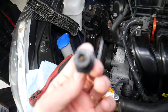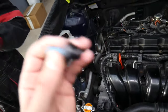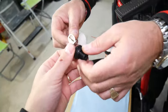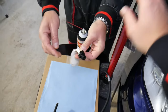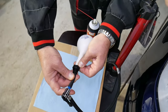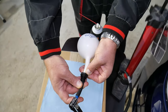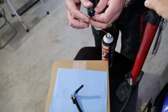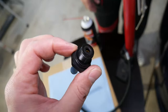Now let's explain how to test it. This is the valve — you can see it's pretty dirty on the inside. When you shake it, you should hear a ball moving inside. Ours does, but that doesn't mean it's working. We'll get a balloon and a pump. You go from the engine side — the valve cover side — and blow it towards the intake side. Check it out: our balloon deflates completely. That means the PCV valve doesn't hold pressure — that's a bad valve. We're going to attempt cleaning it to see if that fixes it.